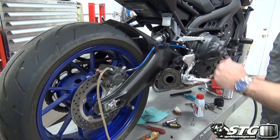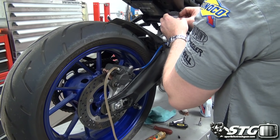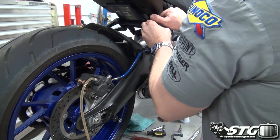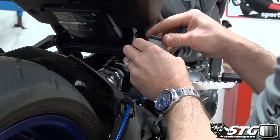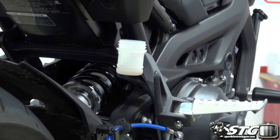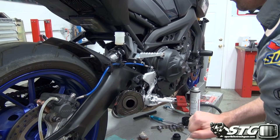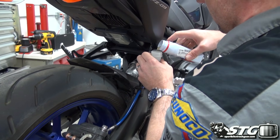We don't have to get in here and clean out the reservoir because there's no real debris in there at this point due to the lower mileage. If your bike's older and you've got a lot of discoloration or debris inside your brake reservoir, you're going to want to clean that out with brake cleaner once you have it empty. Brake fluid is something I would say should be changed on an annual basis for a street bike, and even more frequently for a race bike. Always use fluid from a sealed container — we'll use the EBC fluid here.